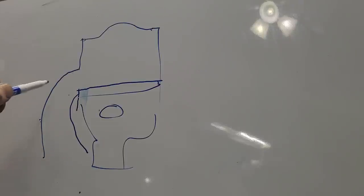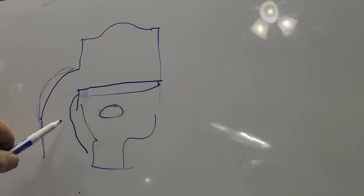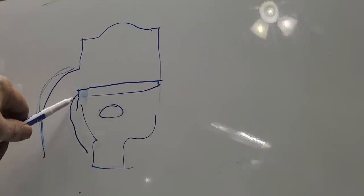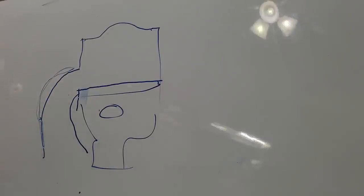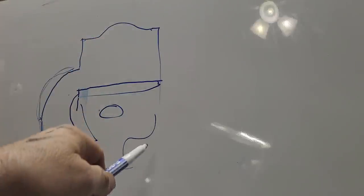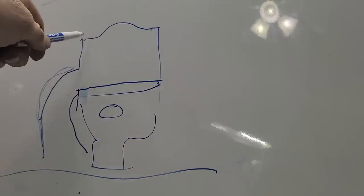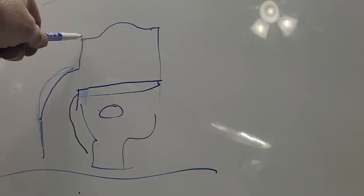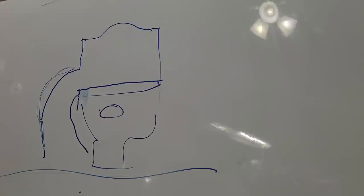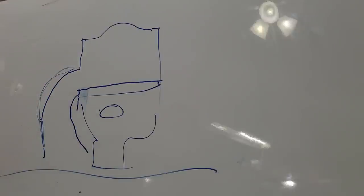As the air comes out — we want it to go this way around the inside of this radius that we've polished and made nicer — but it hits the edge of that piston. As you remove material from the base of the cylinder, if you don't want to cut your piston, you end up removing material from your combustion chamber too. A quick absolute fix is to take this right off and do a taper on your piston — a taper on each side for the transfers.